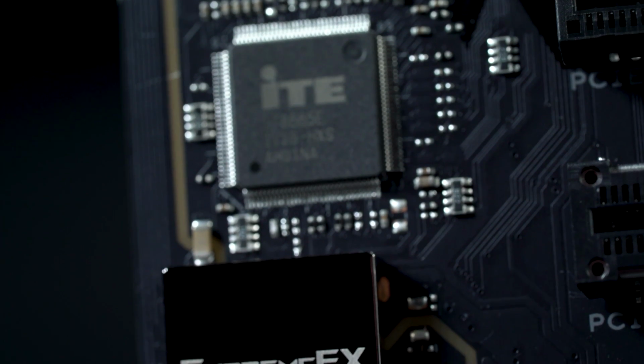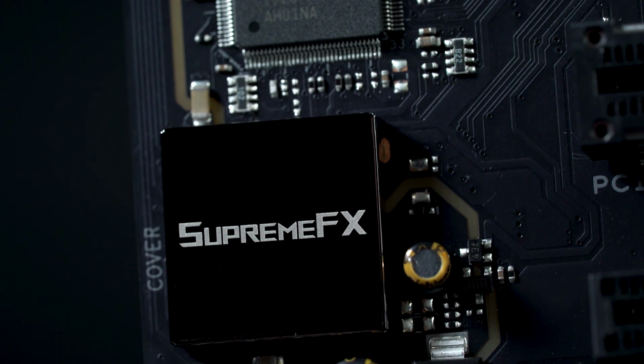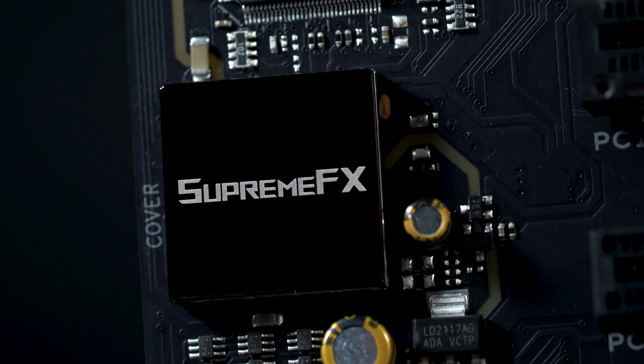Well, you have a fully isolated audio section on the motherboard, which helps to mitigate any type of noise or interference from surrounding components. There's a shielded, high-quality S1220 audio codec, which is great in terms of its performance for stereo, 2-channel, as well as multi-channel content. And it also has an improved level of performance specifically for line in. So if you're a streamer or you take microphone audio quality a little more seriously, you're going to get a bump up compared to previous generations in terms of the overall experience.